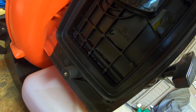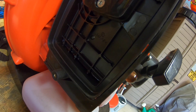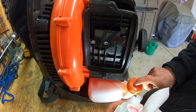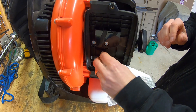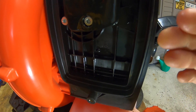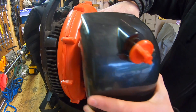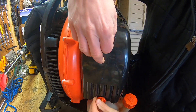I have a little bit of oil residue down below inside these little rivets here and that's common with two-cycle engines. We're just gonna wipe that down — dabbing the paper towel in there. You can see it's red, and that's actually from our True Fuel, which is red in color. So there are no other issues regarding that — it just kind of gets away and that's what we're cleaning up. I wipe this all up, it looks much better. We're gonna put this whole thing back on, line it up, put the filter in, then the cover, and twist on our ends.